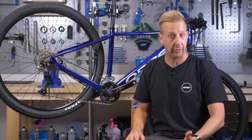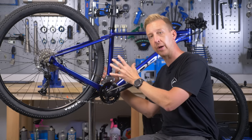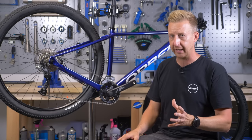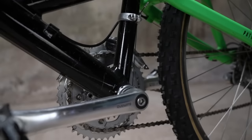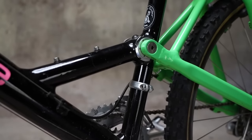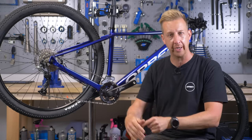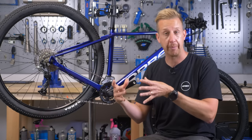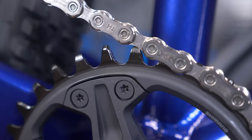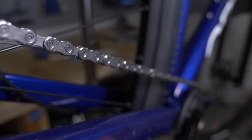Arguably, from a frame design perspective, you can make better bikes. With suspension bikes, it's always been complicated to shoehorn in multiple gears, a derailleur, and the pivot point. Many manufacturers have had to skew their pivot points to one side, making an asymmetrical design, which can put strain on the bearings and result in a suspension design that's not quite optimized. These days, with a single chainring at the front, there's more clearance, more stability, better pivots — it just works better.